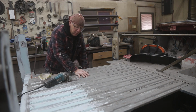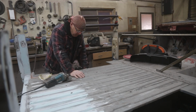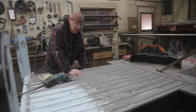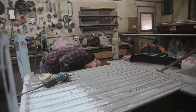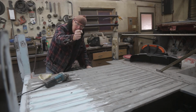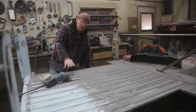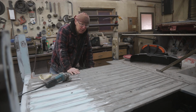So right along here, this is where we did our rust repair, because right underneath there is the brace. And if you're from anywhere in Canada, or a lot of the states too, you know the dirt gets built up in there. It's a really poor design, but if you did the maintenance, if you have a truck like this, just let me look before I start yapping here. This one's closed off on the end, but you could drill a hole, and if you took a blower every year, just once a year, blow out all of your supports, your wheel wells, your truck will never rust. And I say that to a lot of people, and do I do it to my own? Not very often. But if you really care, just a little maintenance and it'll never rust.